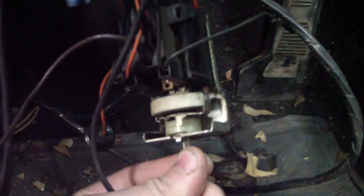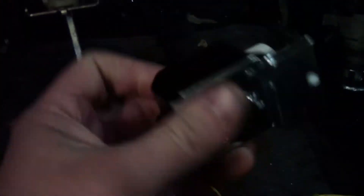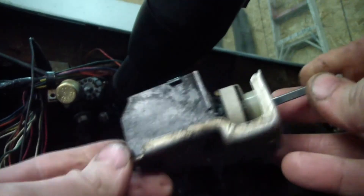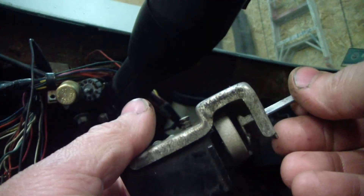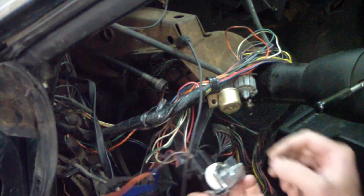I was wondering why the instrument cluster lights didn't work. You turn this for the brilliance on them — it also controls these lights. It turns out this headlight switch is bad. I took some voltage reads on it and the wire that powers all that isn't getting any juice. I was able to find a brand new one on Rock Auto, so we'll see if I can get her installed. Here's the old headlight switch — looks like you just push this spring-loaded button in and the shaft comes right out of it. Here's the new headlight switch installed.